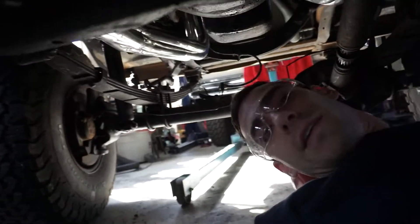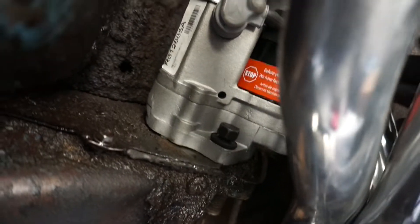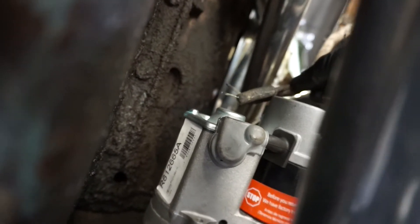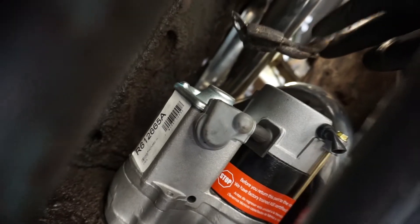An update from down under — the new starter actually does fit really good under here. And the clearance that I made for it the other night on the header: you can see right here in the header tube I beat a nice dent in it, so it kind of fits in a nice dome shape. The wires can pass through in between and not be resting on the header tubes, and I could wrap them with some exhaust wrap just to protect them. I think we're gonna be all right here.